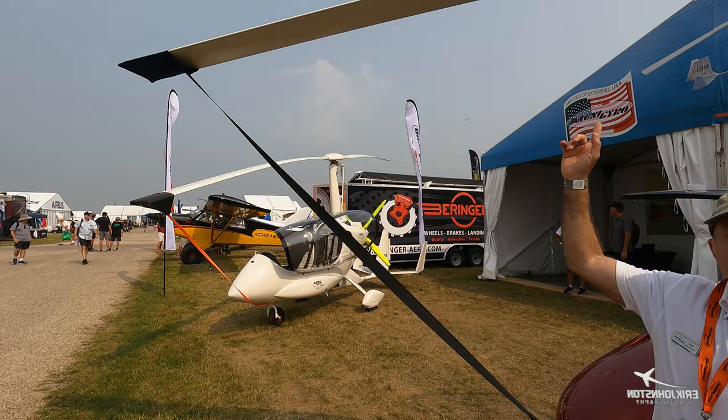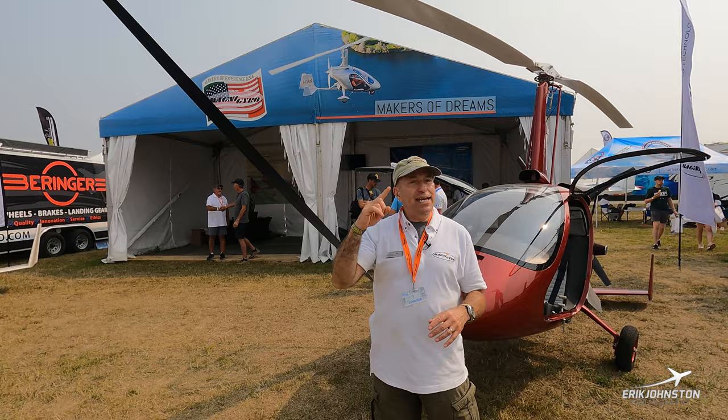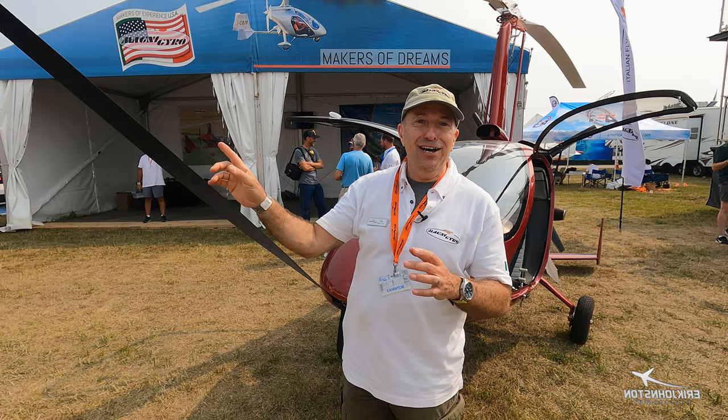In the front here, we've got a really simple tie-down. The gyroplane has a rotor system on it, and the rotor is freewheeling — in other words, it's always in autorotation. So if I took this off and just pushed on the blade, the blade would continue to spin. At the show, we don't want it hitting people, so we always put a tie-down on it so it doesn't spin around or flap around.